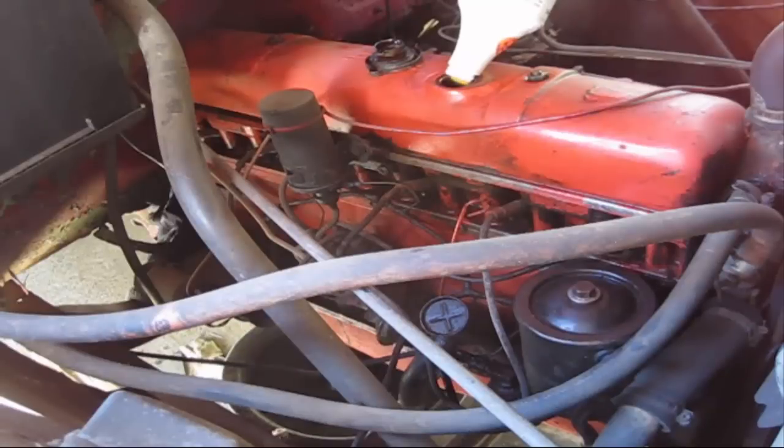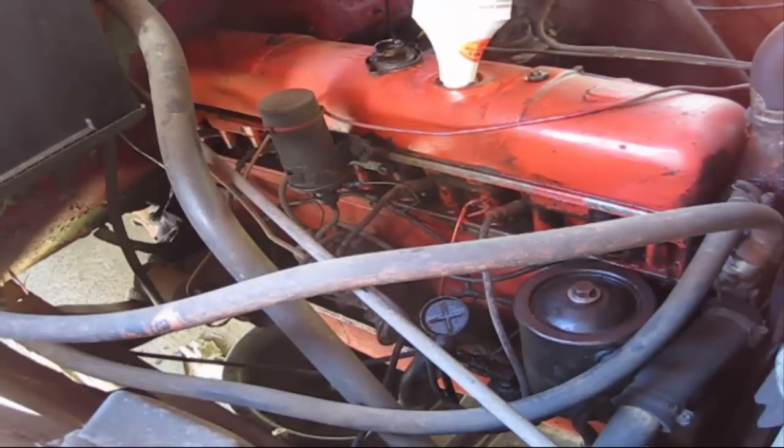And I asked my dad about it. My dad's a diesel mechanic. He's been one for about 40 years now. And he said, oh, it's akin to a Detroit. Detroits can run 5 pounds of oil pressure and still run. It's pretty amazing. He said, run it, it'll be fine. But anyways, I put this Lucas in here to stabilize it, and it boosts the oil pressure from 8 to about, I'd say, 17 when it's hot idling. And you could use more than a quart if you wanted to boost it even higher.